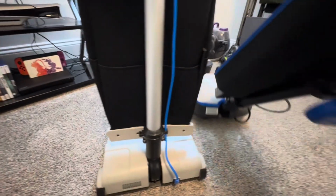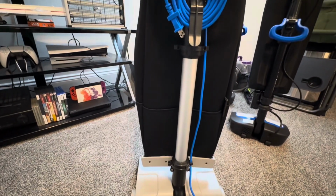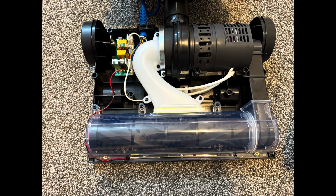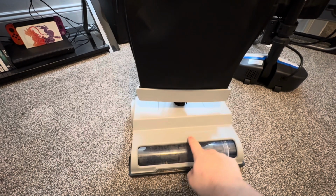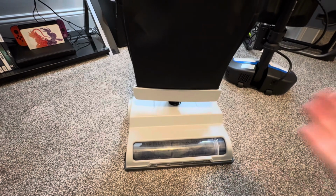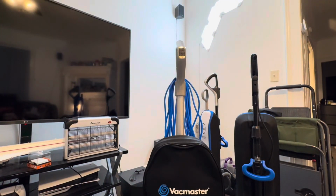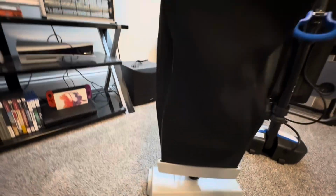So that kind of lent credence to the XL21 thing, but I popped it open, and I'll pop up some pictures here in editing, but long story short, this is actually a magnesium knockoff. It's got the center inlet just like a magnesium that makes that S snake around, and effectively it's a magnesium with a 2-row brush roll and XL21 handle tube and XL21 handle controls, basically a cheapened version of that with somewhat knockoff CC bags.